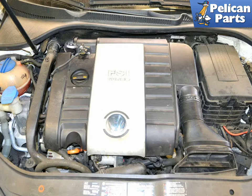While it is possible to replace the right side engine mount without removing all of the lines on top of the engine, I did so to get better pictures. I would recommend removing these lines to give you more room to work and a chance to see what you are doing. If you decide to go this route, first begin by labeling all the fuel lines, coolant lines, and EVAP lines that are in your way and then remove them. They are just a series of hose clamps and push-pull connectors for the fuel lines.